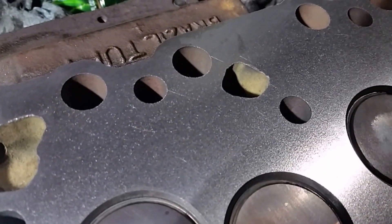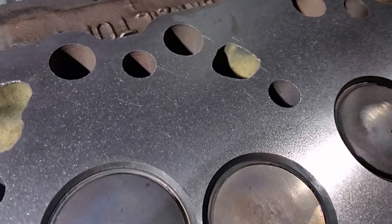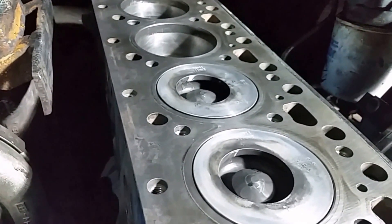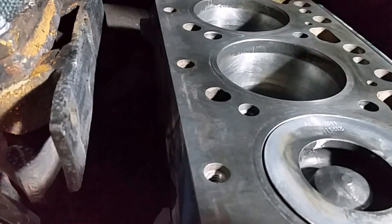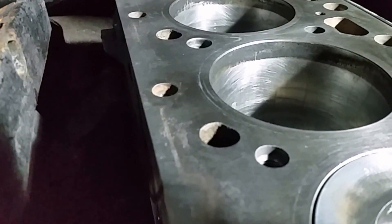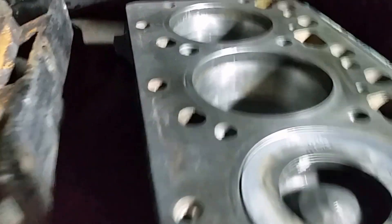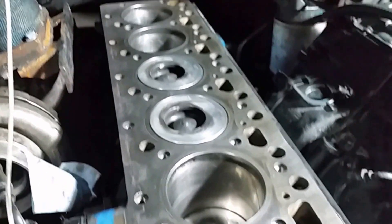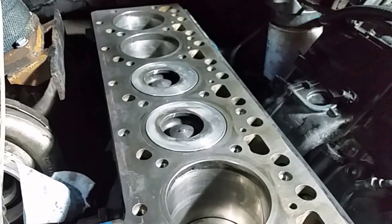To fix it, we sent it off to the machine shop. They only had to take about four thousandths off of it. We've cleaned everything up and it's getting ready to go back on. Here we are over at the engine block and we've cleaned it up as best as we can - we used some red Scotch-Brite and a lot of scrubbing. There's the number five cylinder. The leak was on the cylinder head side, not the block side. We had to pull everything apart and it took a while to get it back from the machine shop, but we're getting ready to put her back together.